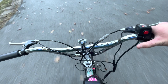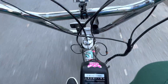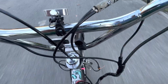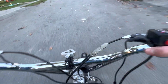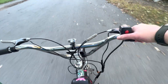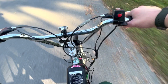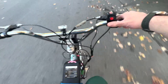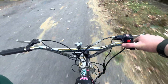This being a three-phase motor, every phase is like a cylinder firing in a car's engine, and I believe that's why it kind of sounds like a car. The hub motor is probably louder since the controller is 36 volts and the battery is 48 — it's kind of like a 48-volt system, but the controller is marketed and rated at 36 volts. This coasts really well.